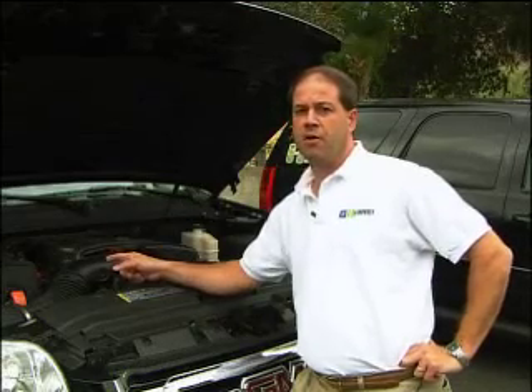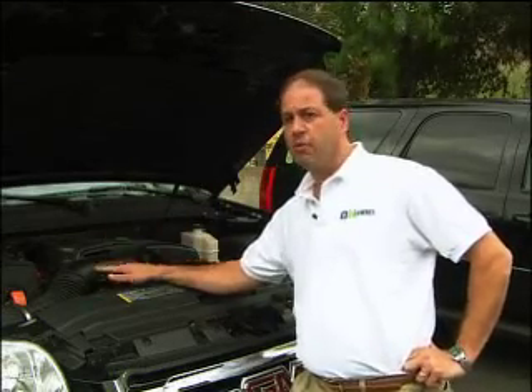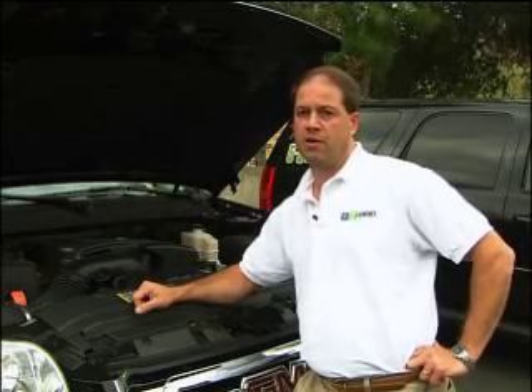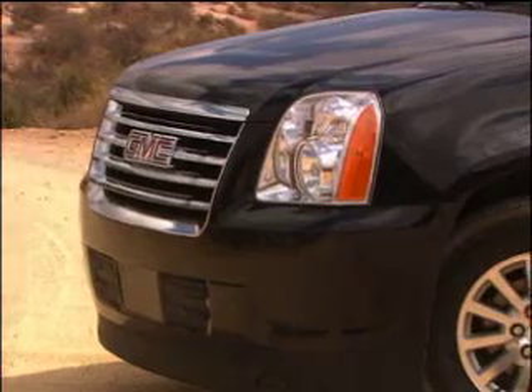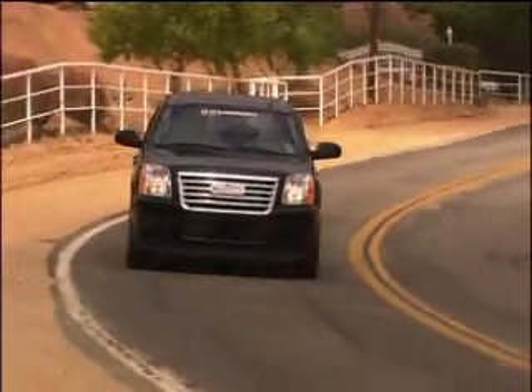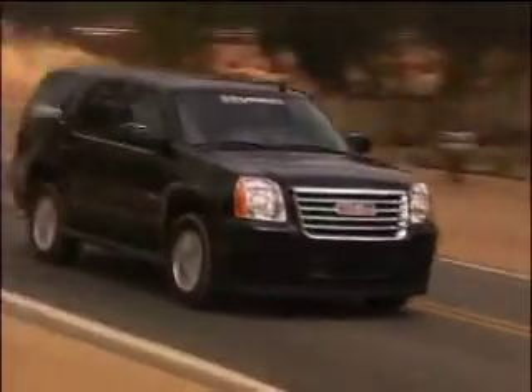That's important, because that's one of the things GM does on all of our hybrid vehicles. When they're 300-volt, you will see an orange cable in all cases — you don't want to mess with that. The big difference between GM's two-mode system and Toyota's Synergy Drive? We put two electric motors inside a transmission case, so the transmission case fits right underneath this truck, just like a regular transmission fits under another truck. Which means any truck on this platform can now be packaged as a hybrid.